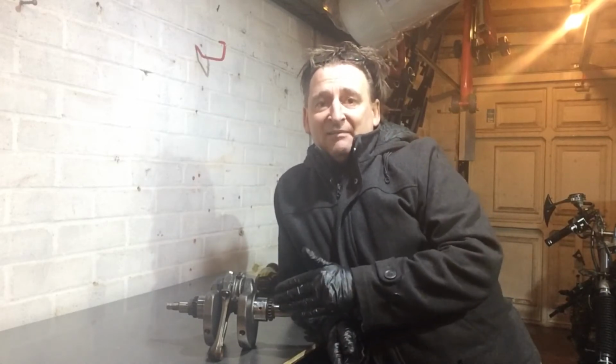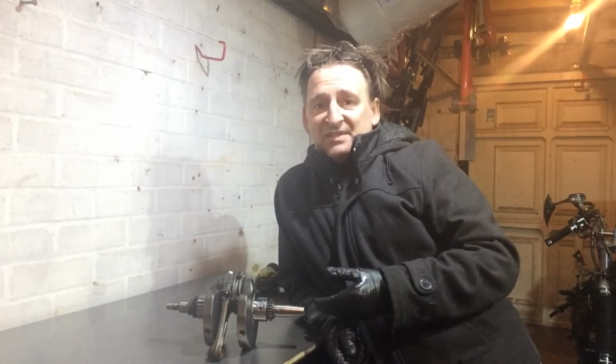Thank you for watching this video. This was part 3 really of the XV535 engine repair. It was the part where I removed the seized crank from the crankcase and extracted the bearing off the journal. That should just slip off and on, as you've seen us just slip off and on, or on and off, the new one. But of course a load of aluminium somehow got down through the oil galleries and seized it up and spun it out. Weird, I don't know.